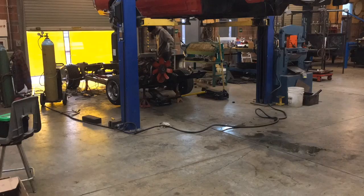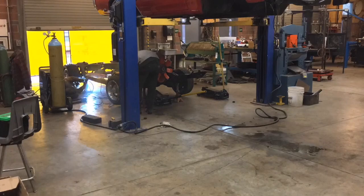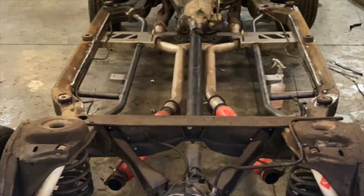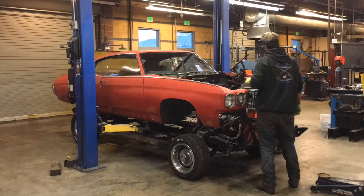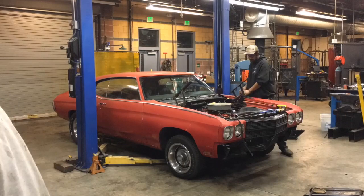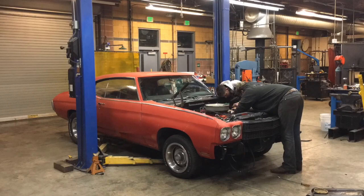My final opinion: this kit is a decent product, but I do not like it as much as the factory-style SS, El Camino, and convertible frames. I probably would not buy this kit again — I would just make my own. The basis of this kit is some 3/16" sheet metal sheared to approximately the same thickness as the frame, so if you have access to a shear, save yourself some money. The other pieces are 1.5" 120-wall tubing that I don't think are even needed unless you're doing hardcore drag racing where the frame might twist. That said, it's a decent kit. We did it in about 11 hours — me and one other person — and the result was pretty decent. Thank you for watching.